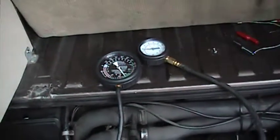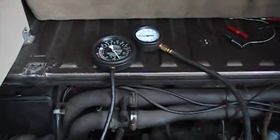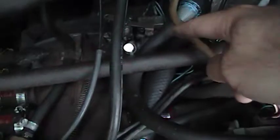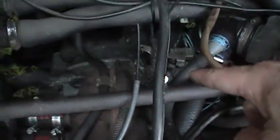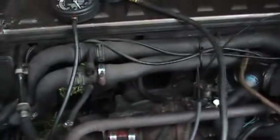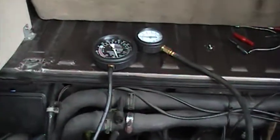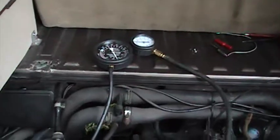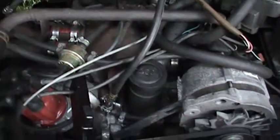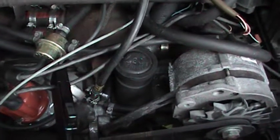That may well have answered my question, because if you remember, when I put the vac — this thing used to be plumbed up to the throttle body. Now I've got it plumbed in here, and the vac does a very different thing. Let's shut her down and see what happens. I'm going to try re-plumbing that. Here it is plumbed the other way — and it just died again. I can't even keep it running that way.